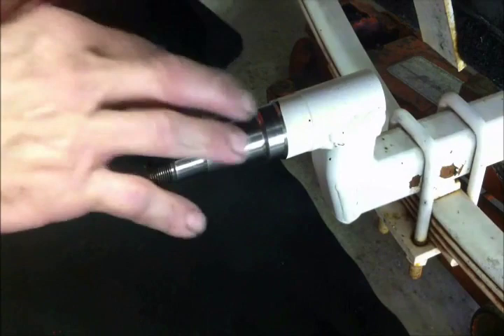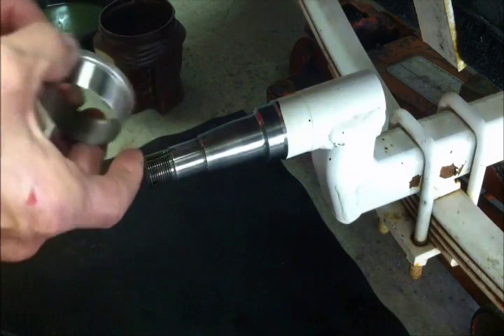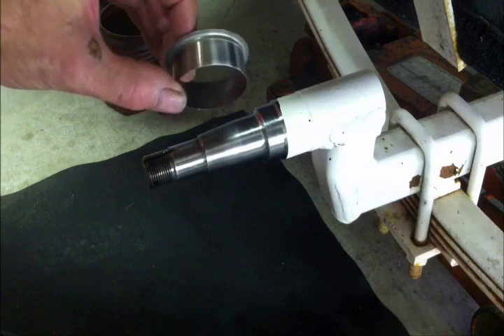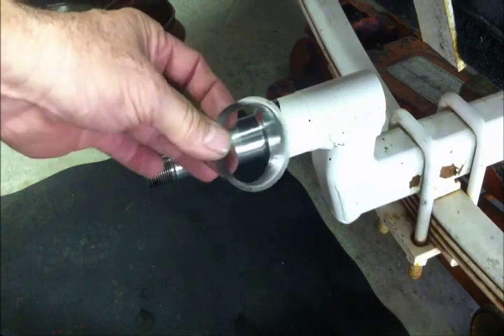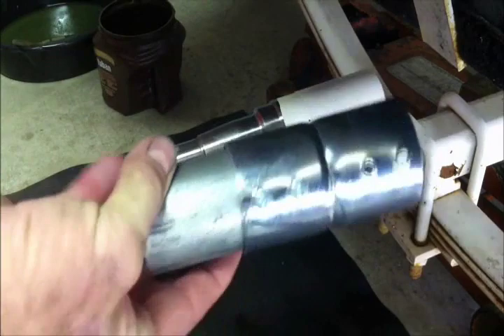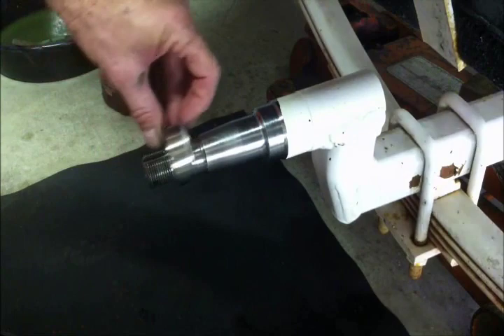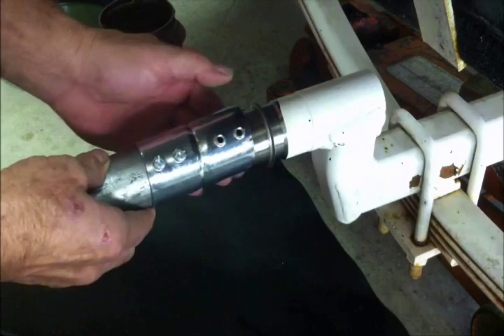The kit has directions and a little tool to drive it on, which is worthless here because it can't fit. Here's the sleeve - it's pretty cool, it's very thin. You don't even have to get a special seal; the original equipment manufacturer seal for the trailer still works because it's so thin. In order to get it on, I made this little tool out of an inch-and-a-half EMT coupling and a little piece of EMT.